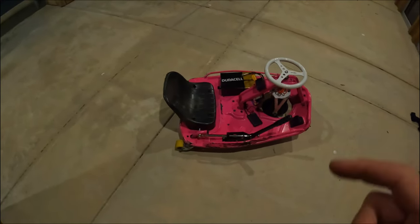This is a stock wire pass through for the motor wire on the stock carts. Those wires pass through here under the speed controller. The speed controller actually has a really nice 3D printed bracket that mounts directly to the stock mounting holes for the stock Crazy Cart controller, which is also super convenient. It literally took me minutes to install the speed controller. And those wires from the motor run directly behind the speed controller to keep them kind of neat. And they plug into these bullet connectors here that come out of the speed controller. Let me see there, there's a blue, green, and a yellow. And that is how the speed controller communicates with the motor.